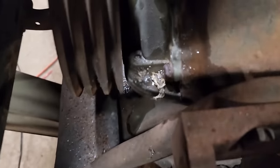All right, one more update before I call tonight out here. I am getting some leaks. Let me show you. I was working on the carburetor. I went ahead and hooked up the fuel tank, put a little fuel in it, and the carburetor overflow was leaking. Had to go in there a couple times, tweak the float level on the carburetor. Seems to be doing good now, but while I was doing that, I noticed a couple things developing in the cooling.